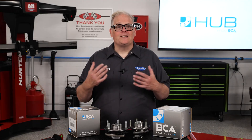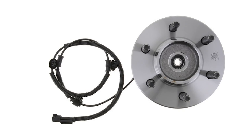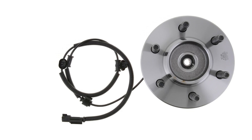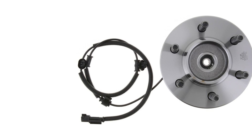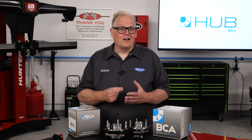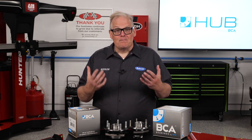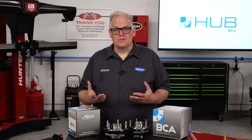When the parts arrived, we examined the hub unit from BCA. We've ordered other hub units from other brands and had problems. First, we noticed that the wheel speed sensor wiring harness was the same length as the original and had the correct connector. We also found that the harness can be too long or too short on some economy units, as many companies try to go for a length that might fit multiple years and applications to fill out their catalog.